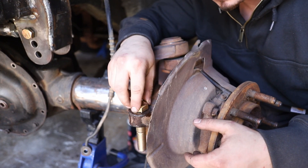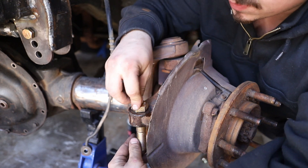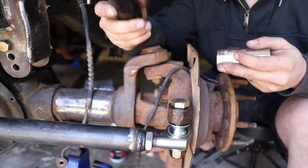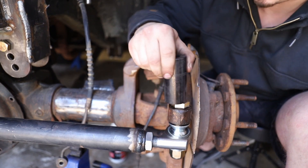We got this done, but the hardest part of the entire drilling process is when you get to about an eighth to a quarter inch before breaking all the way through — the drill bit gets stuck every single time. You just need to find a place for the entire drill to brace so it doesn't hit you in the face. Put it on full blast, get the RPMs up, then slowly inch it down until it catches, and eventually after about 50 attempts it'll go all the way through. It's very tough near the bottom. Now this bolt can just slide right in — not much play on each side. It's perfect.